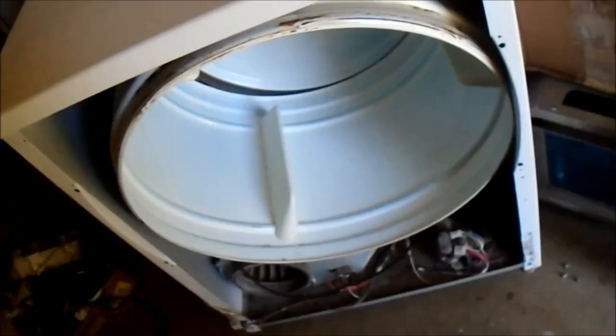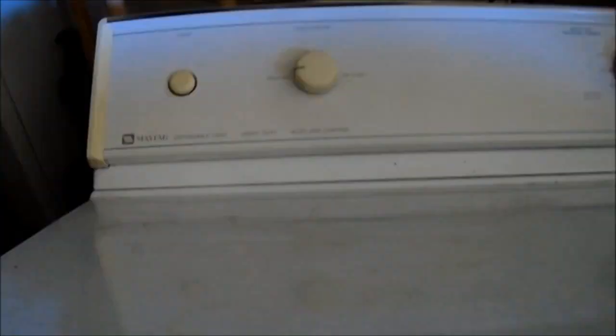So the belt on this is a little bit tricky sometimes. I'm going to go around the back and take a look at it. We can see this blower wheel — we got a little bit of lint built up on some of the fins, and I want to clean that off. When this blower wheel hooks into the center, sometimes on dryers that blower wheel is not connected to the motor. What happens is the spline on the plastic blower wheel gives out, and this thing will just rattle. It won't heat very well — the clothes will take a long time.